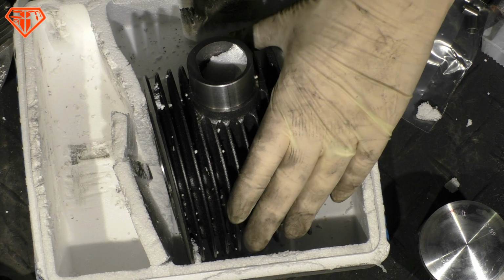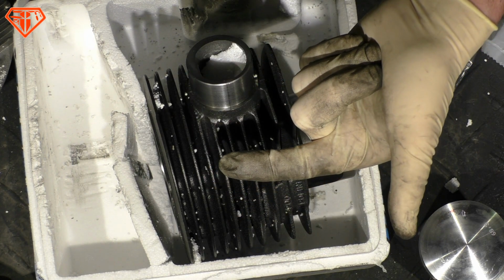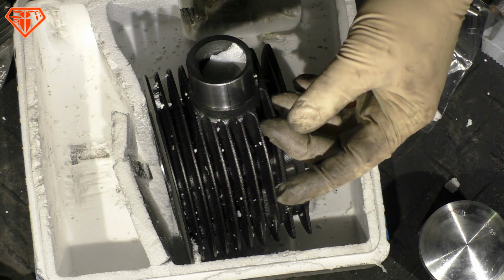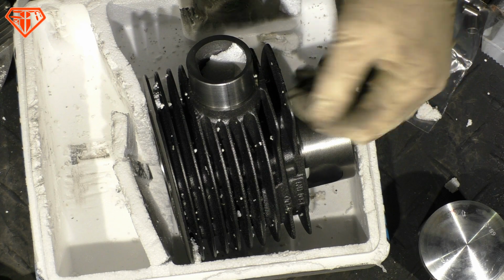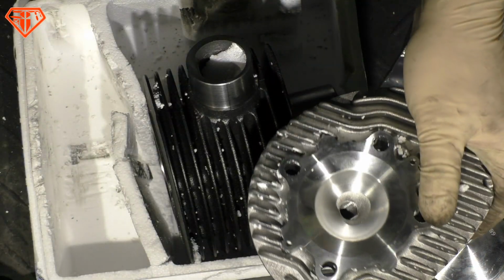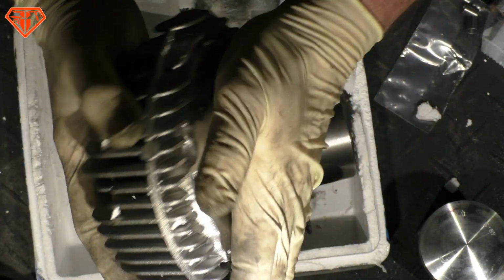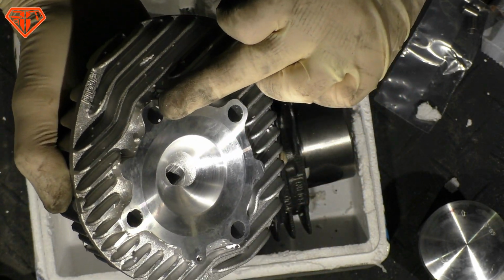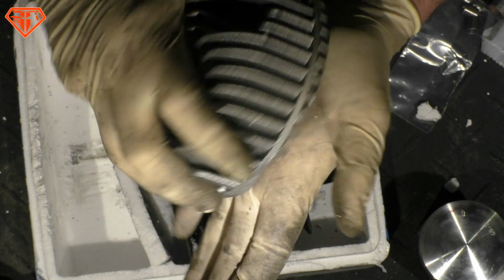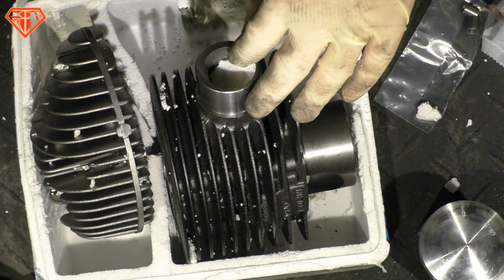Why is that? Cast iron, thicker rings, and 210. This just means you take down the old 200, 198cc cylinder and just put this stuff on, and it even comes with a cylinder head. Don't forget to just sandpaper it. It's never tried out of the box. You take a 400 and some grease, some oil, and sandpaper it properly. Also the cylinder bottom, then you mount it with a sealing compound.